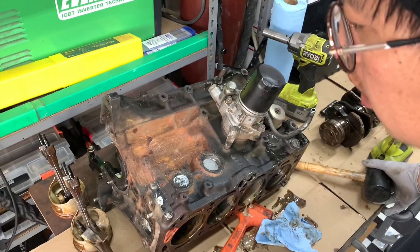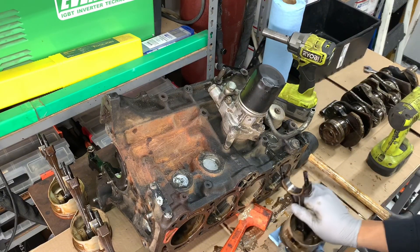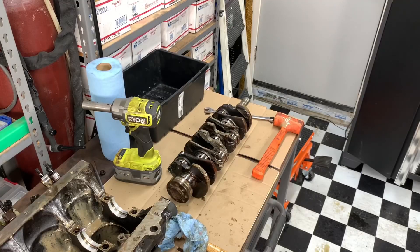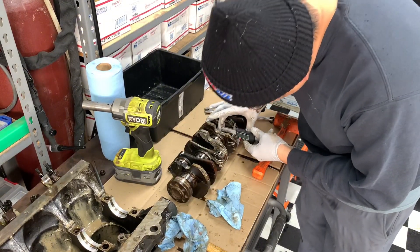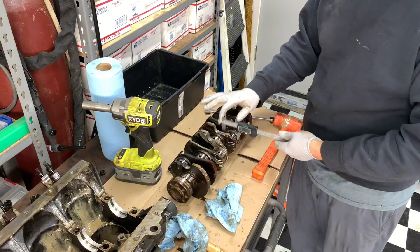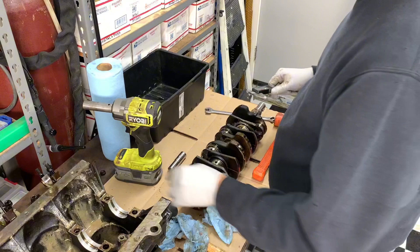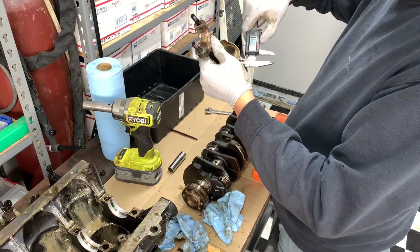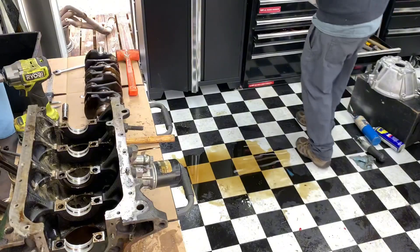Number two — lots of milkshake. Number one — lay them out: four, three, two, one. 4AGs had different crank sizes, so we're going to measure the crank journal. Zeroing the micrometer and going to millimeters since it's a Japanese engine. Readings: 39.85, 39.86, 39.82, 39.85 — 40-millimeter on the big end. The small end looks like there are no C-clips — 18-millimeter. So this is a later block with earlier internals — I believe second-gen bluetop. This is important because I'm going to need to order the right parts.